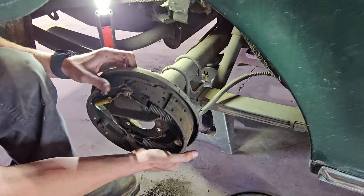Now I'm going to take the brake line off of the back and pop this off. In order to remove our emergency brake cable, we have to pop out this clip here. Then I'm just going to get the front of the cable off of this clip and feed it back through and pop it out of that bracket.